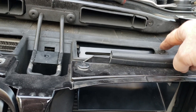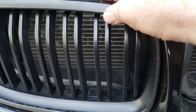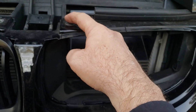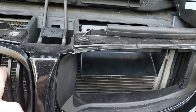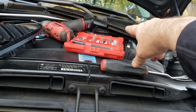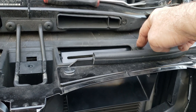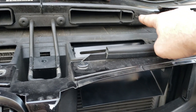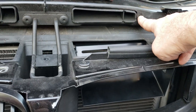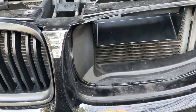I actually put that clip in before I put the duct back in, so I've got to pop it back out. I'll put the duct back in place, put this clip down, and you just want to pop your grill out so you can put the duct in place and tighten it down. Do the other one with the grill out, tighten it down, then put your duct back in place and pop in your clip and your screws that hold it — they're star bits.